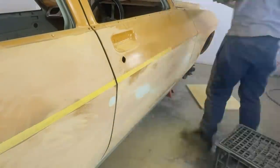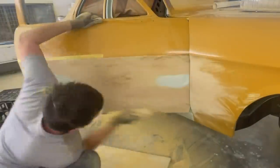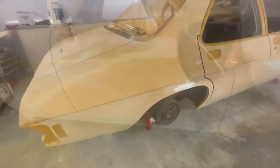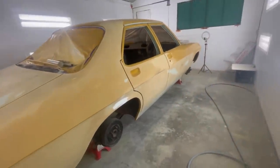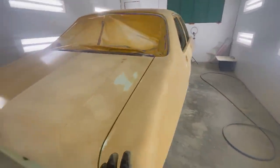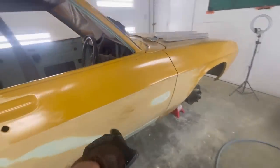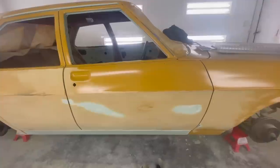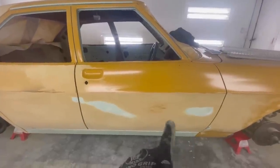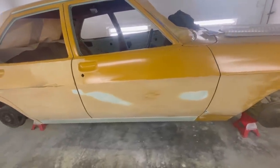This door did have quite a large repair done to it, so I was sort of holding my breath thinking I might have gotten it, but I don't think I did in the end. As you can see I've broken back down to my filler work and there's a little bit of a light spot in the middle. I've just been blocking down this side with a bit of 180 and a little bit of 120. These panels - the boot lid, lower halves of the doors, lower quarter - they only got two coats on them so they haven't got a whole lot. I've noticed a few little low spots in a few places, most noticeable one's probably in the center of this door right here. I reckon my filler work must have been a little bit high, so I've given that a little bit of a chop down with some 180. If it probably had four full coats on it, it probably would have filled in that low spot in the middle. But it's only got two coats, so I'm going to give that a little bit of a prep up and wipe some filler in those areas.